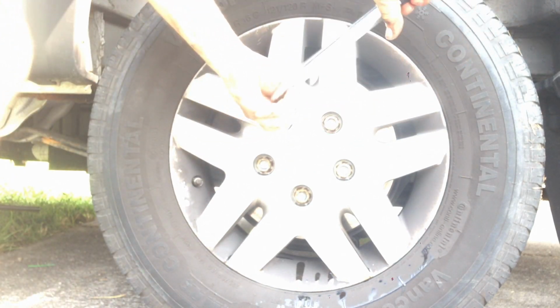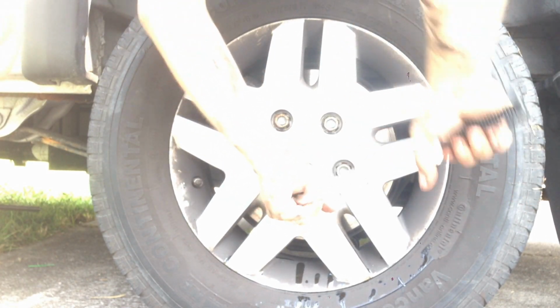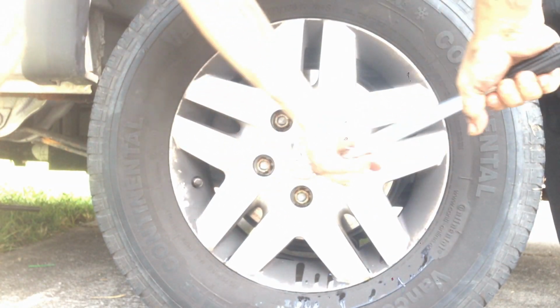Oh, I'm gonna need a bath after this. All right. Do a little bit more. Okay, and that's snug enough to let it down for contact to keep it from rotating, so that I'm torquing with the weight of the tire a little more on the ground and not just torquing against the brakes and potentially knocking the whole thing off of the jack.